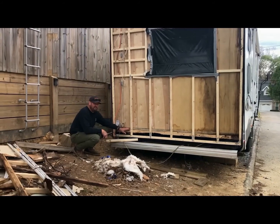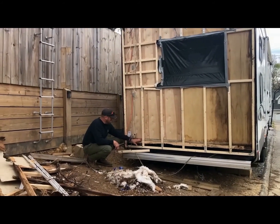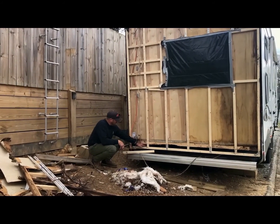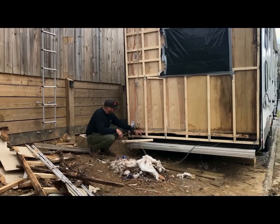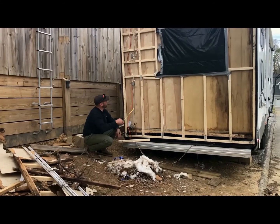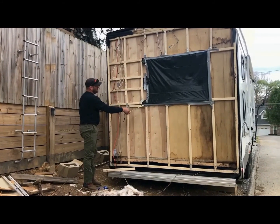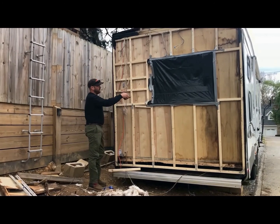That way it seals off the wall from any exterior rodents or anything else. I want it blocked off from here, not here, because that's going to be open space of air coming in and all that, and flowing in the carpet right here in the back. So we're going to measure each one of these, cut pieces, put them in there, and then we're going to start reinforcing up here on some of the frame that I had to cut and reinforce, because I was off by about 7/8 of an inch on my window on top to bottom.